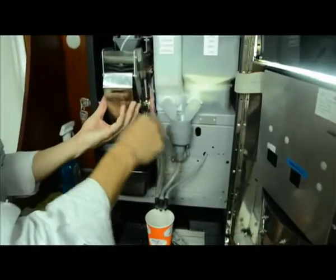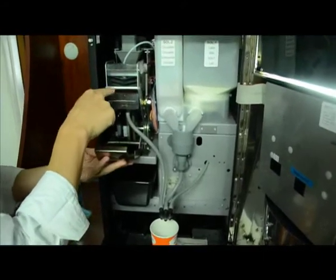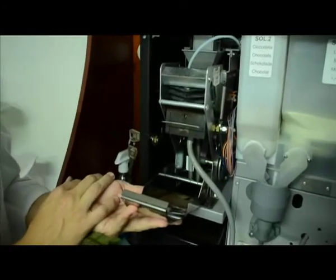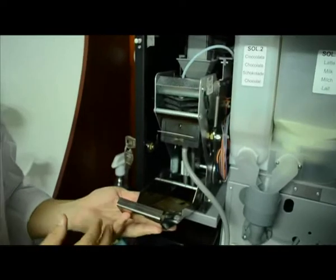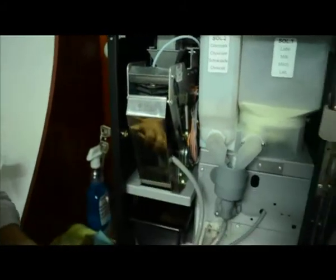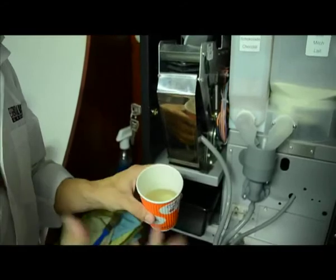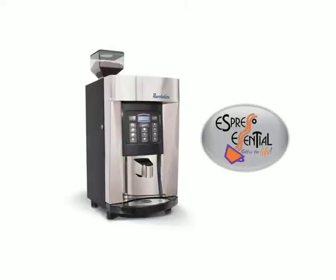You'll see it does the actual mixing bowl section first, and then you'll see it actually do the coffee section — just a bit of water gets dispensed there. That is one of the best ways to keep your brewer perfectly clean and your mixing bowl really clean. You can do this once or twice, but this is one of the most important parts of keeping the long-term maintenance of your coffee system and the quality of your coffee in excellent condition. That wash cycle should be done every single day.